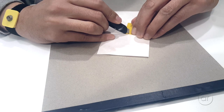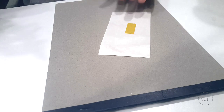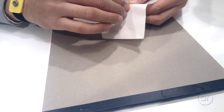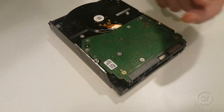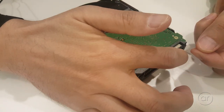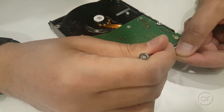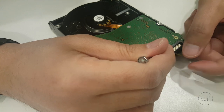As you can see, it's yellowish in color. It's a special type of non-conductive tape that's stable at both low and high temperatures. Next, I'll bring in the hard drive, locate that third pin, and gently apply the tape. I highly recommend that you use an ESD wrist strap while you're doing this, as you're touching the contacts of the drive.